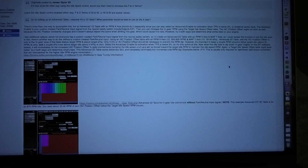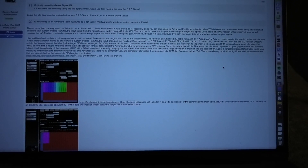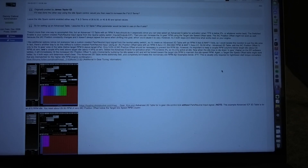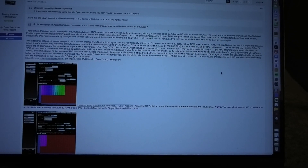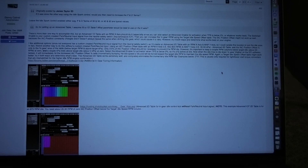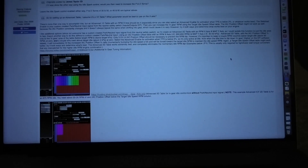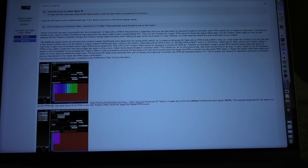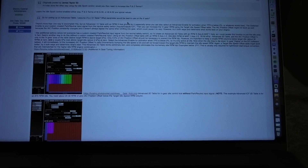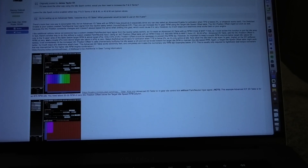That's going to wrap this one up. I want to make sure I'm rock solid before the next step, which is getting it on a dyno and having somebody who can actually tune it. You're never going to get the best mileage or peak horsepower without getting it on a dyno and having somebody really fine-tune it. I'm considering taking it out to West Tech — Steve is a pretty well-known and famous guy. There just aren't really great options in Southern California for dyno tuning on a Holley, which is hard to believe.